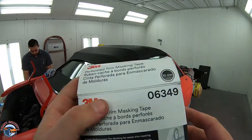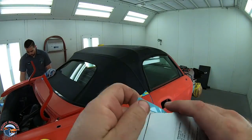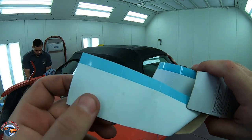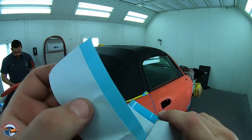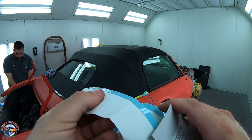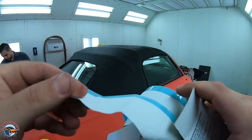Now we'll leave the link in the description, and this trim tape comes perforated, which is nice because you can tear it off. And you don't want to work more than an inch and a half, 2-inch piece anyways. Now it's got a hard edge right here, and that's gonna go underneath the trim, lift it up, and then you can tape it back.